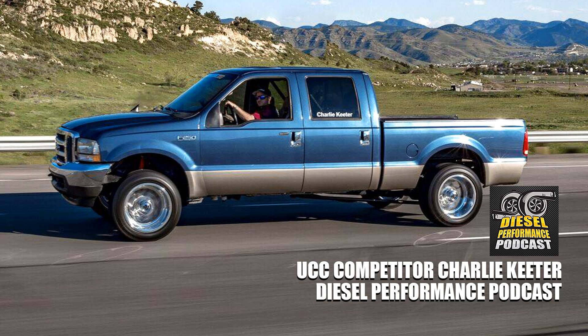That brings us into Exergy's do's and don'ts — do run anti-gel additive. We're saying don't pour a full bottle of 911 into your truck. Anti-gel isn't expensive — it's not as expensive as a tow. You might be paying $2.80 a gallon for fuel and think you don't want to buy additive, but you're not paying for a tow. Don't leave your truck on a quarter tank with no additive, parked outside in negative 20 degree weather, and expect to drive to work in the morning.